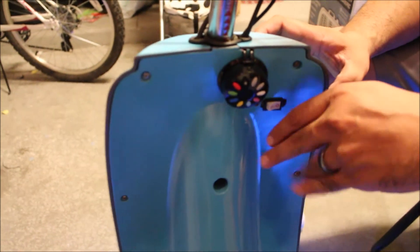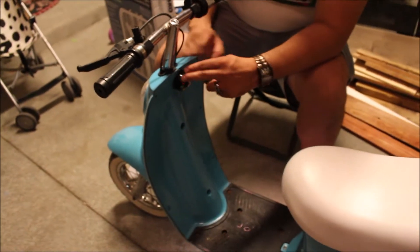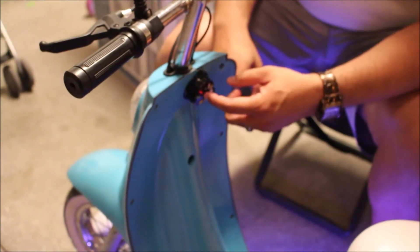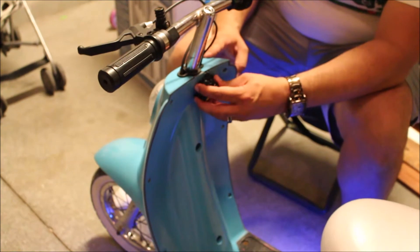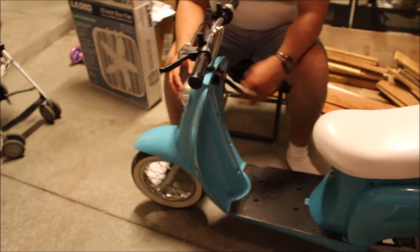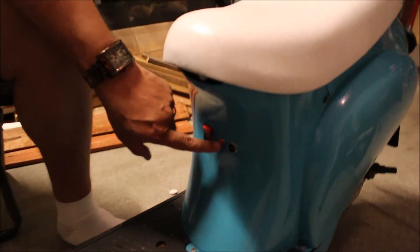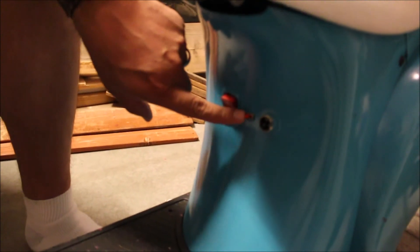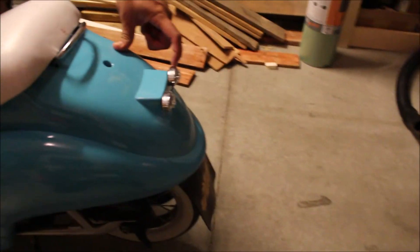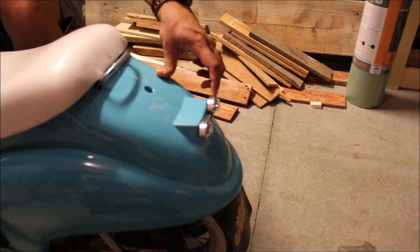For the floor lights below the electric scooter, all I did was cut some notches for the two outgoing wires to wrap around and go down, and then I drilled a hole for the bottom. The switch itself has 3M tape so it's stuck on there pretty good. Between the power button for the scooter and the charging port, I added another small switch — this is what turns on the LED tail lights located in the back. They're steady lights that come on; they don't blink — just to make the scooter more visible.